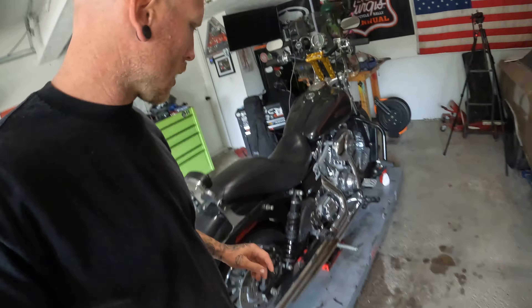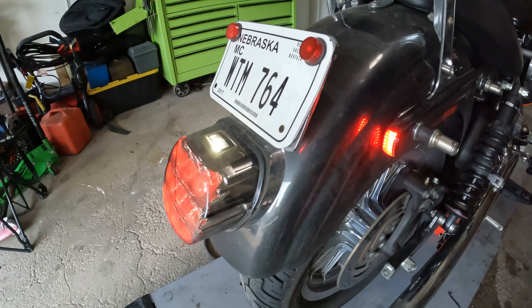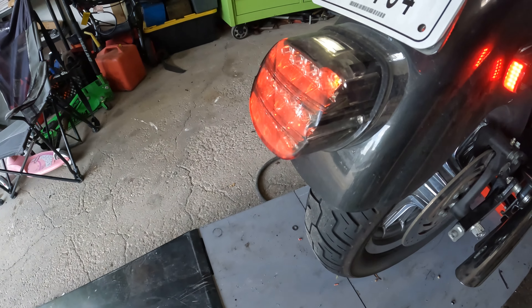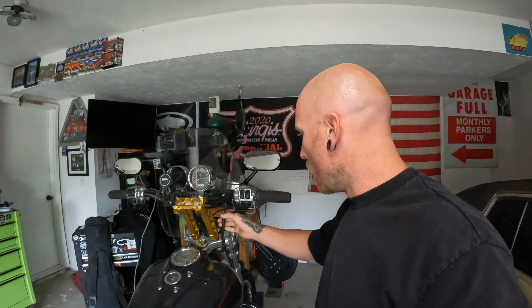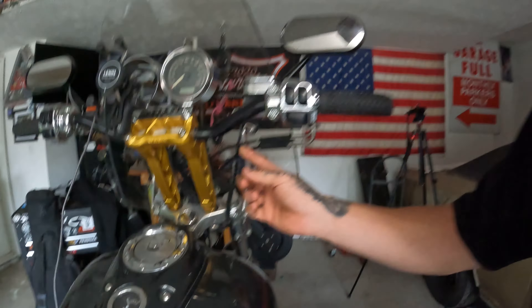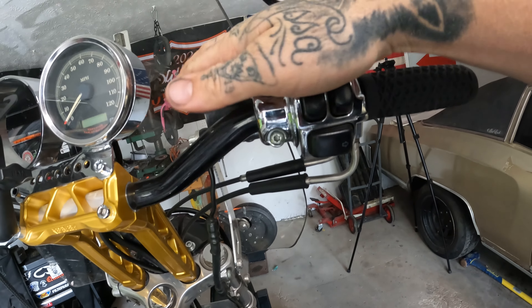What is going on YouTube, I am Brandon, you are back in the Gilstrap Garage. Chances are you clicked on this video because the brake lights on your Harley are staying on, just like mine. I'm going to turn the key on — we got some pretty bright lights back there. I'm going to hit the brake pedal, nothing changes. I'm going to hit the brake lever, nothing changes. It's usually something pretty simple. This started happening after I put these tall bars on — there's a little bit of a stretch with this brake line because parts of it are steel, so it's pulling on this housing, and that's where our problem is going to lie.